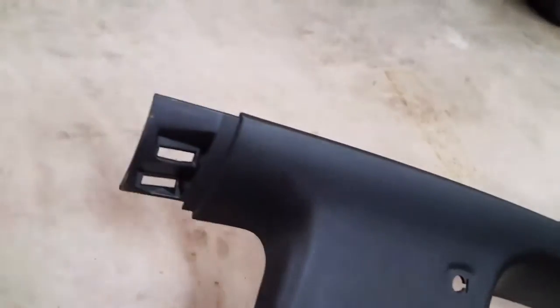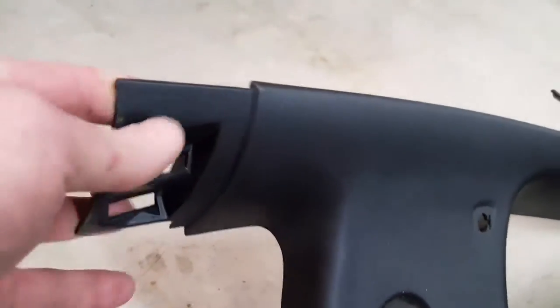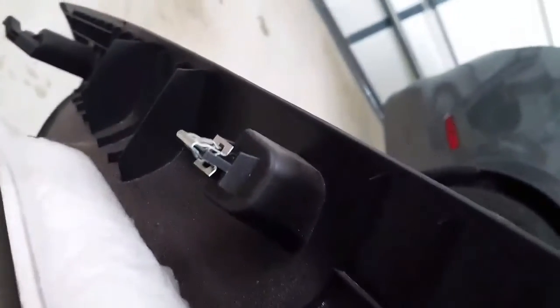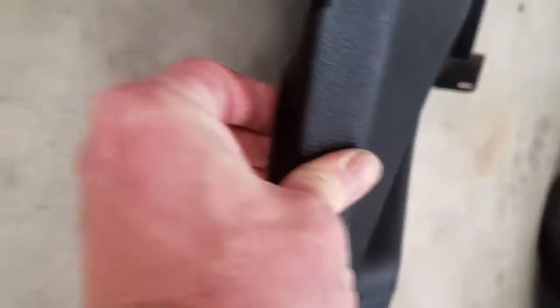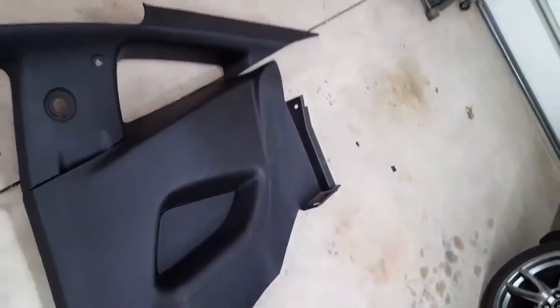When you remove it, you've removed your A-pillar cover and now it's time to get started on this one. These just have a couple of simple clips on the back side — one, two, three, four. The back one has a little angle, so this one kind of slides into position. Once it's slid all the way back, then you can just pop one, two, three, four of those out. Your seatbelt will need to squeeze through here. This comes out real easy. Once you've pulled these away, this needs to come off your door — there are no clips on the back side and it just wraps around the edge of your door. Make sure you've got these buttons pulled out and the whole piece then just pulls out as one solid unit.